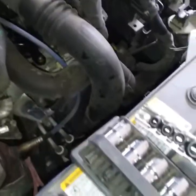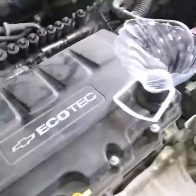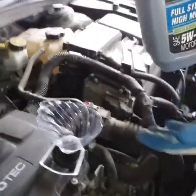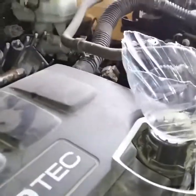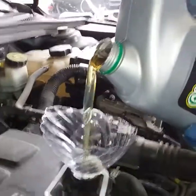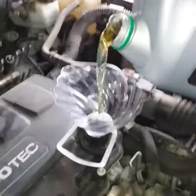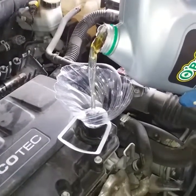Nice. So that's what we got off a gallon that I used to put the oil in. So we're going to use this because I don't know what I did with my funnels. But perfect, too. It fits great. Never used one. Usually I make them a little bit bigger. But so we're going to do 5 quarts of full synthetic 5W-30. Yeah, there we go. There she goes. Pour most of it because it's a 5-quart container. So just pour most of it, and then when she starts, the jug gets pretty light. You can just check how much you got.